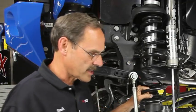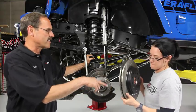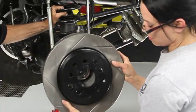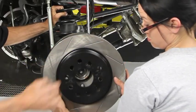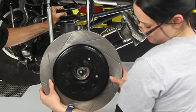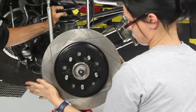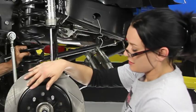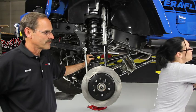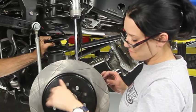Pick that one up and let's throw it on here. That's a little heavy. Try not to get your greasy hands all over the rotor surfaces — anywhere you touch on that you have to brake-clean it off and make it clean, because if you get grease all over this it'll make hard spots when you use your brakes. There are two sets of holes drilled in here: one for a five-on-five-and-a-half bolt pattern and one for the five-on-five. Let's go ahead and put our lug nut back on there just for safety. Rotor installed.